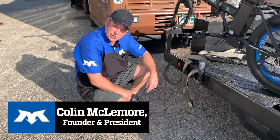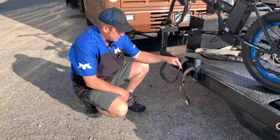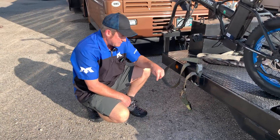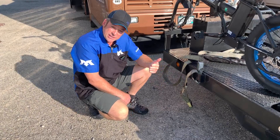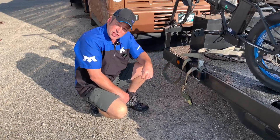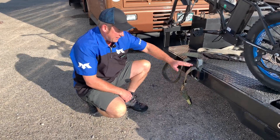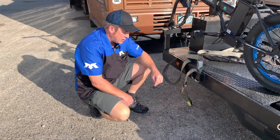This is a great application for the max chain extension right here. This strap is clearly used off of the stake pocket — both ends of it are coming back to the stake pocket with a wire hook. That depends on strap tension to keep those engaged in the stake pocket. Not only that, when the webbing comes up and out of that stake pocket, anything it touches is sharp and will quickly lead to a strap failure.